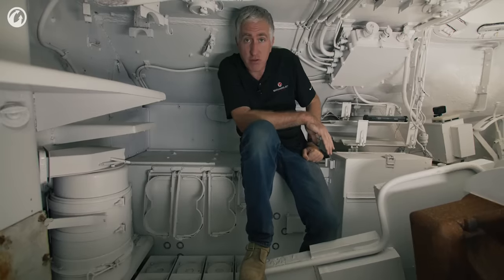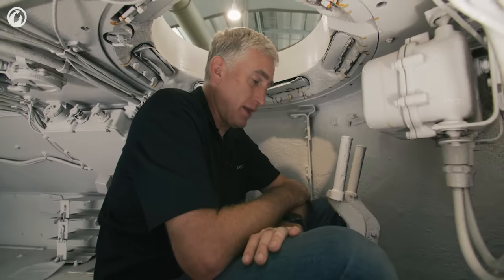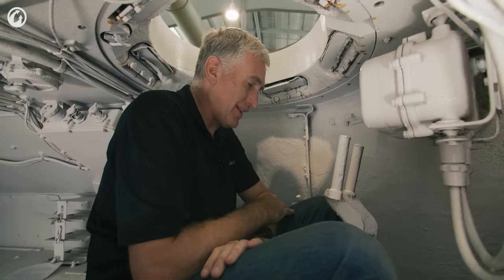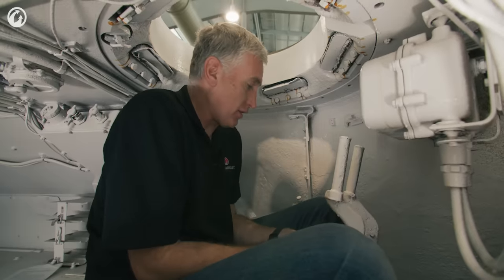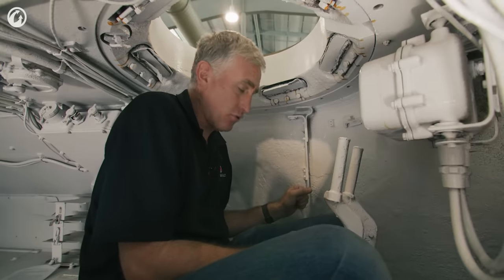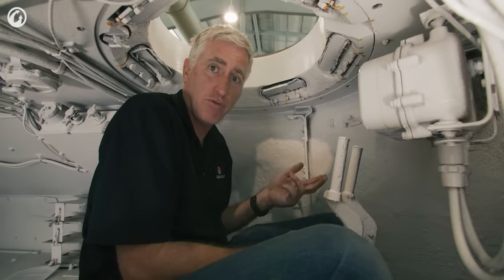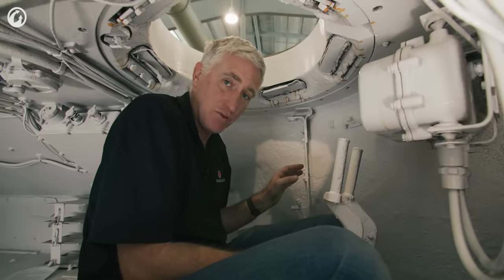And that brings us to the driver. When you get to the driver's seat, I think you actually found a comfortable one. I've ridden it quite nicely, actually. The seat is adjustable in elevation, at least it would ordinarily be. Controls are a little bit complicated compared to other vehicles of the time, such as the Pershing, of which the transmission is, of course, based. So there is the selector for the automatic transmission, or Hydramatic, on the left-hand side. It's got two ranges, low range, which is basically just first and second, and then one to three. Ordinarily, you just set it in third and forget it.